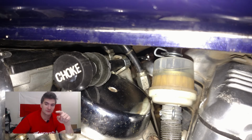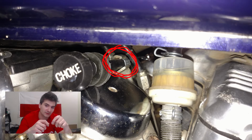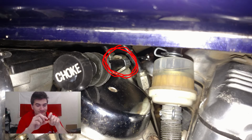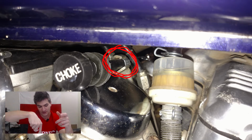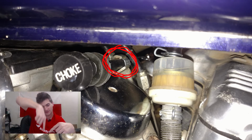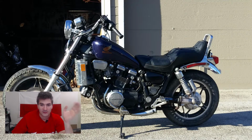The good stuff is also to have a pretty long screwdriver, because the little bolt that you need to fasten in order to make that little clampy thingy latch onto the actuator can only be bolted on after you lift the tank and go straight up. But if you have everything put together with the air filter and so on, you don't really have much space. So it's really good to have a long screwdriver, dive in there and tighten it from the top. There we go with the bike, kind of put together.